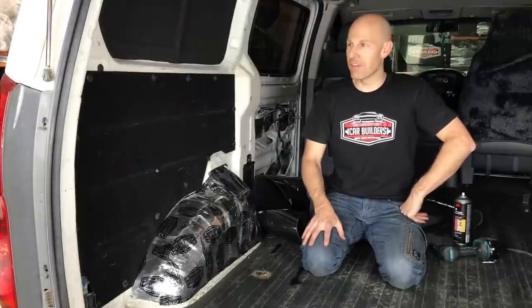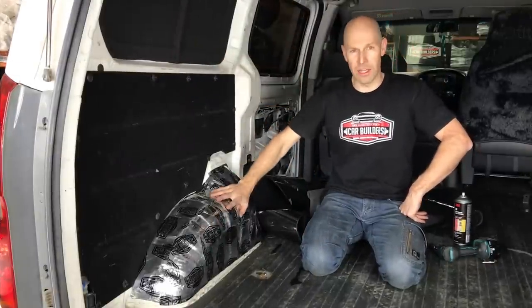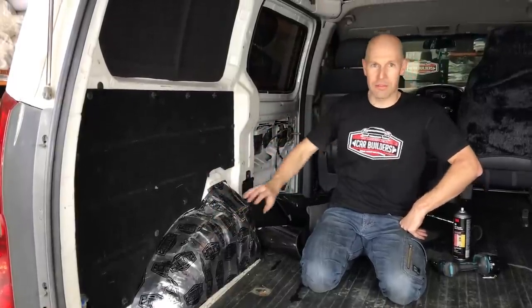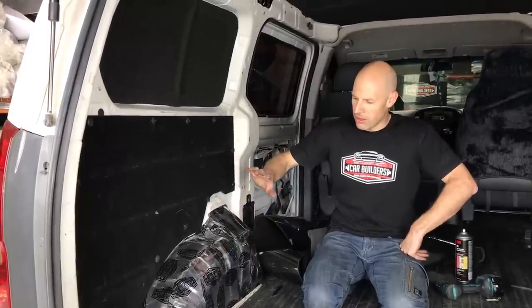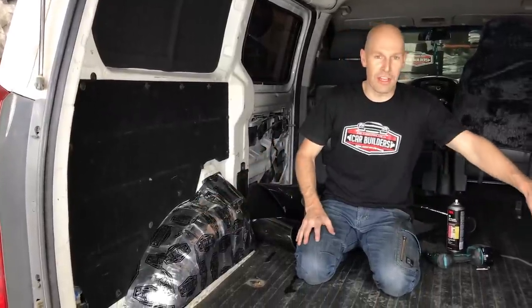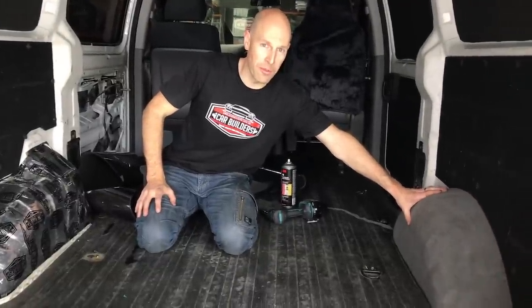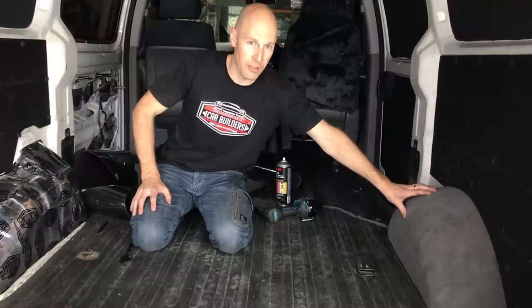to be there anymore. So this is the basic van pack, which gives you your walls and your roof, and your wheel arch is insulated. We've also done inside the rear quarters. You can see in this door a couple of sheets of the dampening panels. So the other option you have is, do you leave this finished in the deadener, just raw like this, or what we've got over here is we've upholstered it, we've put the 6mm foam on it, and then we've also put just a stretch carpet over the top of it so it looks finished.